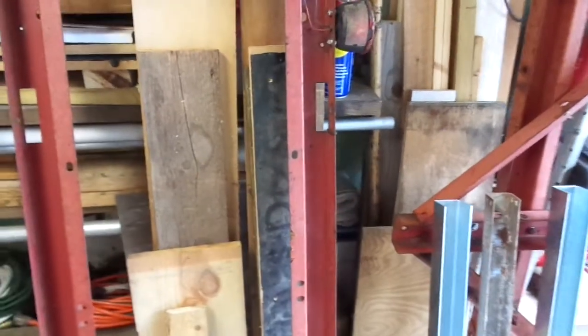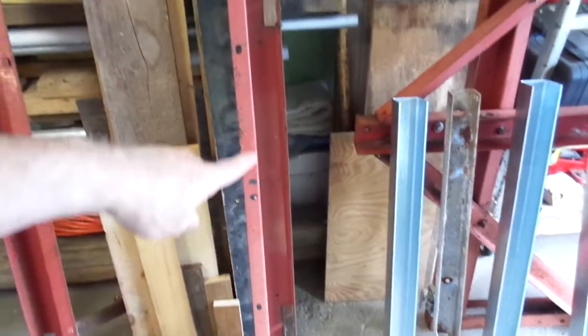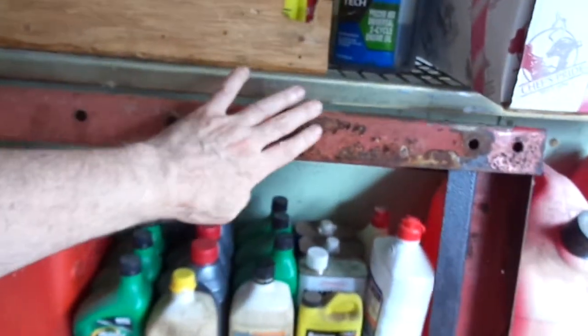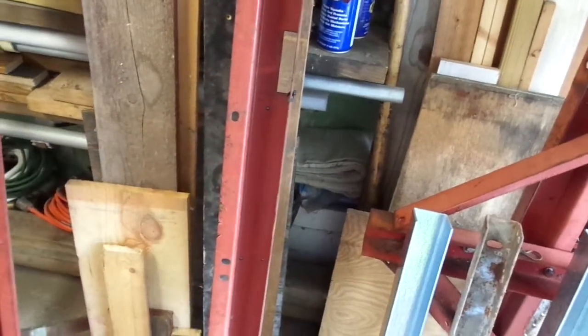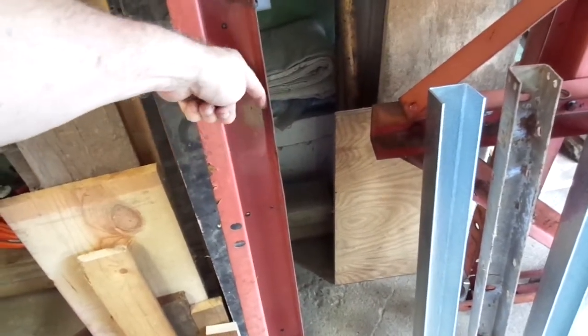The thing I need when I get to the meetup — and you'll probably see some of this too — is I'm going to need a support piece in here. This is the very back piece of the trailer that has been putting all that pressure, like a giant lever all the way up to about this part of the trailer, and then up to the front piece and causing it to bend because it created so much stress. If I put a support piece in here, from now on when I'm loading anything with the ramp I'm going to have a jack stand underneath so that it does not flex down.